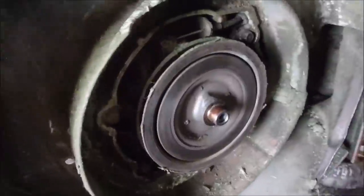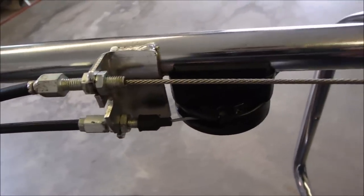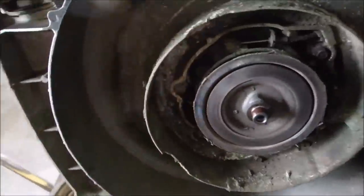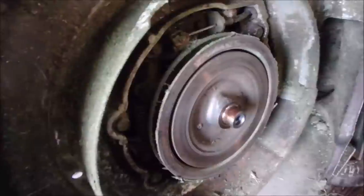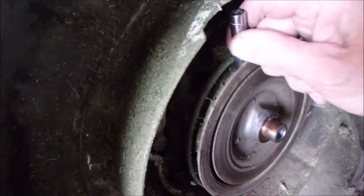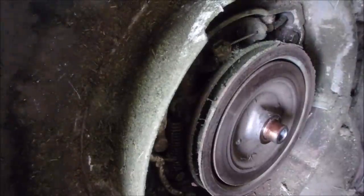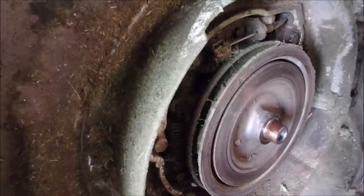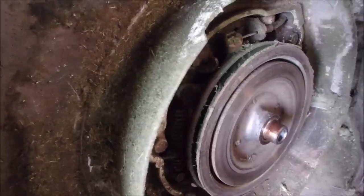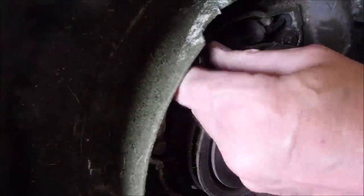Looks like it's never been touched. Okay, so that's at rest - it's still not tight, but there's no droop in that. I moved that about a half an inch - maybe that might be too much. But usually with a cable like that, you can take the slack out of it. When I checked before, I had just this eight millimeter socket space in there. I don't know how much that's going to change. Let's get the clamp on. Oh, that feels better - it's much tighter.